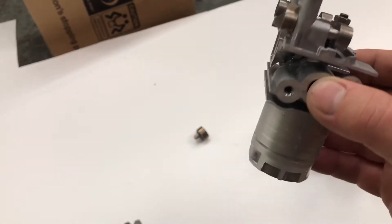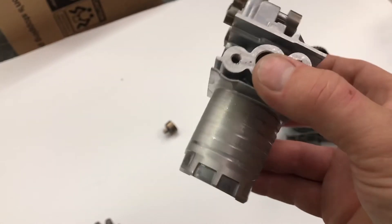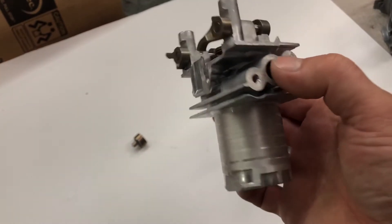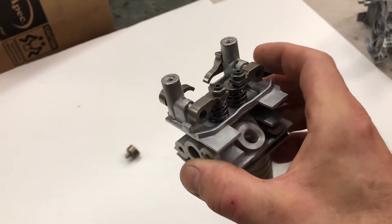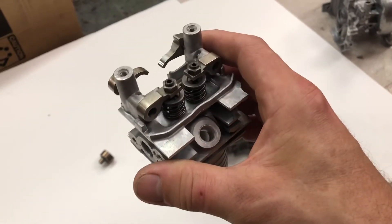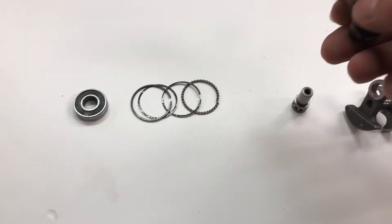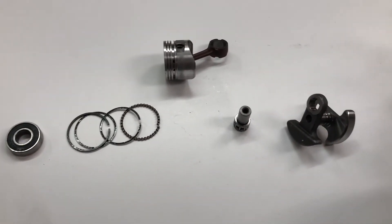It's quite a lot of work to modify these, but of course you get valve guides, valves, a Nicosil liner, and hardened inserts — so it'll run on unleaded fuel, and it's obviously a four-stroke engine as opposed to a lot of the small two-stroke engines. That just gets me nearer to where I want to be. With the engine being water-cooled, electric start, I want it to run with oil in the sump, be sort of self-contained and clean to run. Buying engines that are already made — especially four-strokes — means you get nice pistons and rings, and it's all repeatability with a multi-cylinder engine.